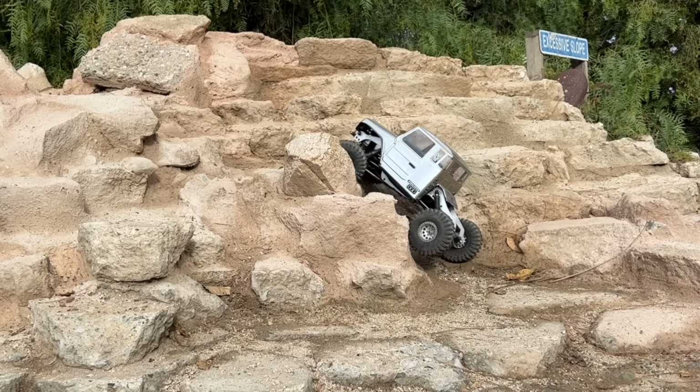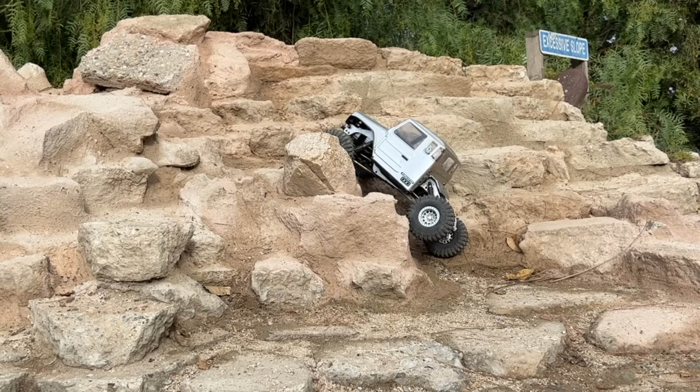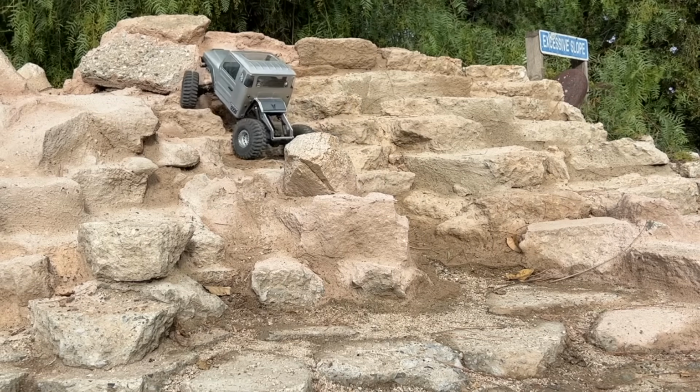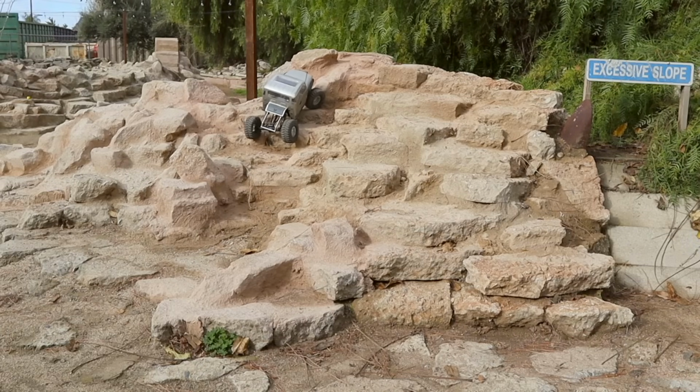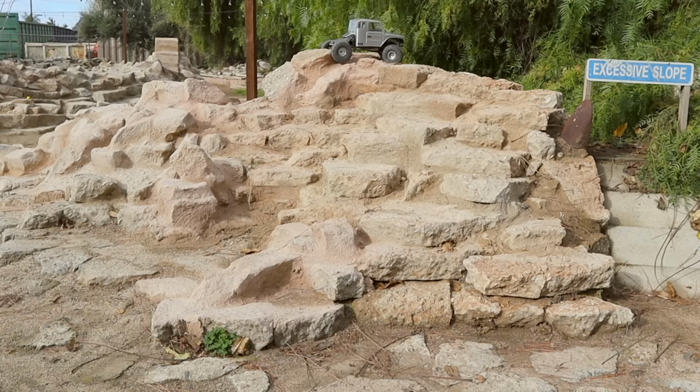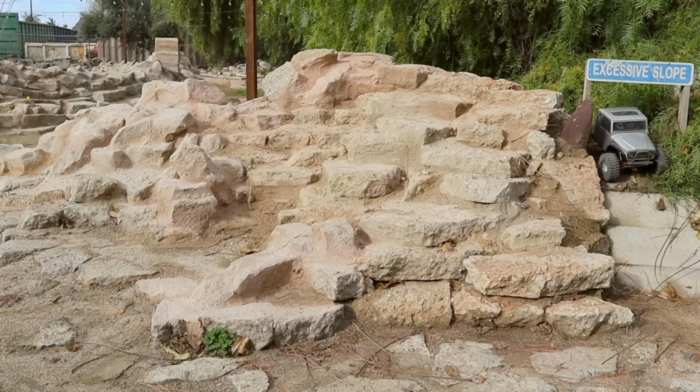Also, if you really want to do something for the hardcores, sell a straight axle set, sell a portal axle set, and then also sell a set that's a straight axle front and a portal rear. If you sell a mullet set, you won't be able to keep them in stock, because every actual comp guy that can get away with it under his ruling will be putting a mullet in. Because why wouldn't you? It's just better breakover and departure. If there's a drawback to the mullet, the only drawback is that most of the time you get stuck having to buy a pair of axles, and then you have an extra axle sitting around, which means you have to build another rig. So I wouldn't even call that a drawback. If it's an excuse to build another rig, then that's a net sum good.